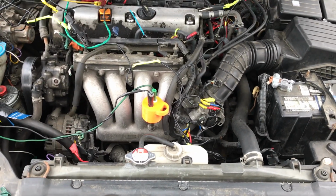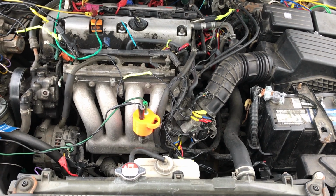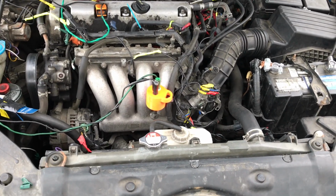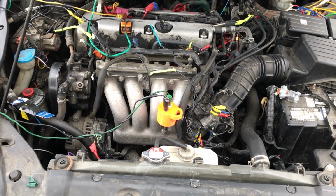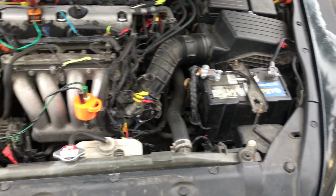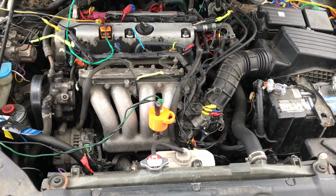There's a lot of information we can relate to our microphones because they tell us our transfer points in the valve train, especially when valves open and valves close. We know that valves are opened by camshafts that push on lifters, that push on push rods, that pivot rocker arms and push down on valves, and we know valve springs close valves, and all the associated components with the valve train, intake and exhaust.